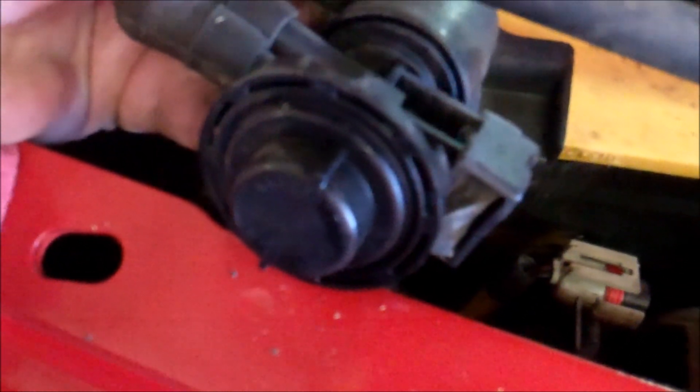I've got it hooked to my supply line off of the solenoid, and I believe that down there is going to be the smog pump. One thing I have a question about — I'll have to read the info on it — is I thought this was supposed to be attached down there. It'll go down through here, back through, down through where I originally saw it was disconnected. If I had a Schrader valve attachment, I could smoke test it this way or pressure test it that way, back down through here, and I believe back down to the gas tank.